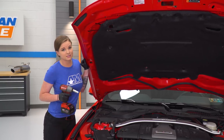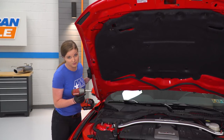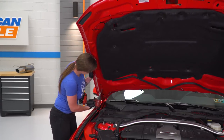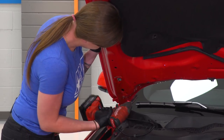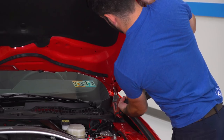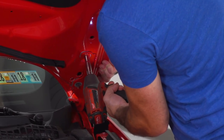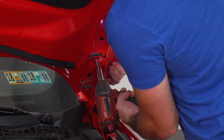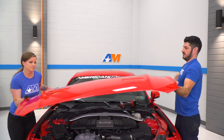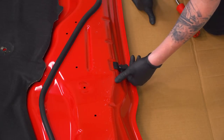At this point you're ready to remove your hood completely. You might need a second set of hands — it's really gonna make things helpful. I have a 10-millimeter socket. We put the hood prop down, we're gonna hold the hood really high up so we can reach these bolts, and we're just gonna remove them. We have the factory hood laid down on a piece of cardboard just to keep it safe.